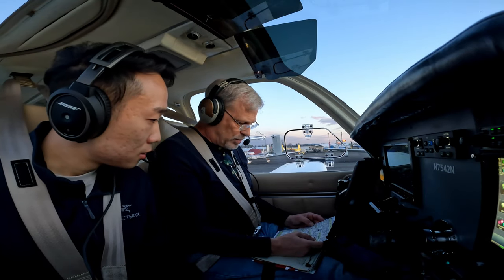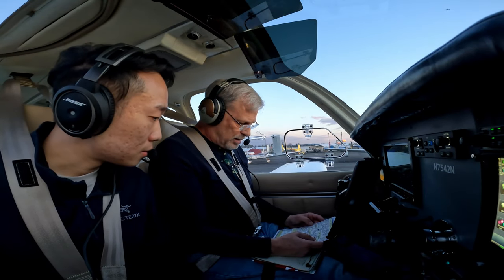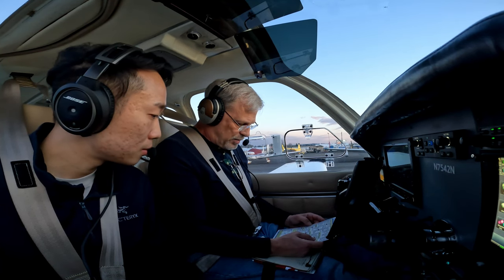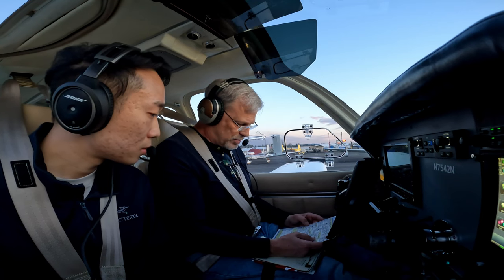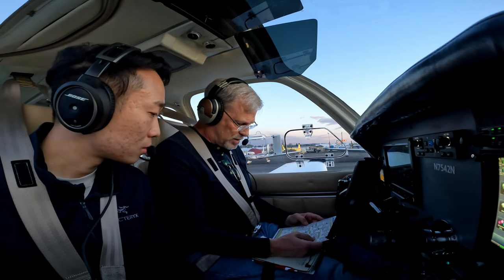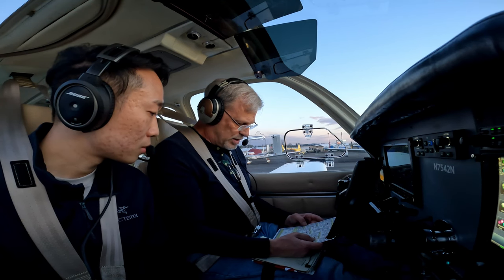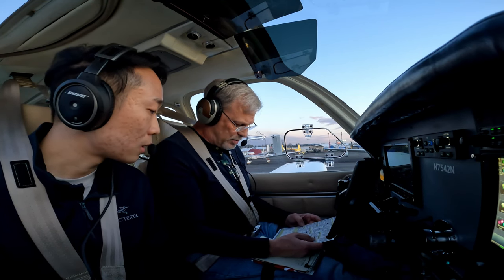We are full on our fuel quantity. We're good there. We've got all our engine oil. We're at 10.5 on the engine. All props good. Exhaust system's good. Pitot-static ports are good. Gears, surface controls, gear, tires, brakes, antennas, we're all there. There's no chocks, no tow bar on it. Cabin doors are there. We did the walk around. Passenger brief, I think I've talked to you about a few things.